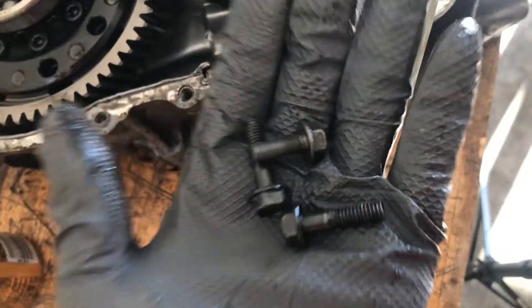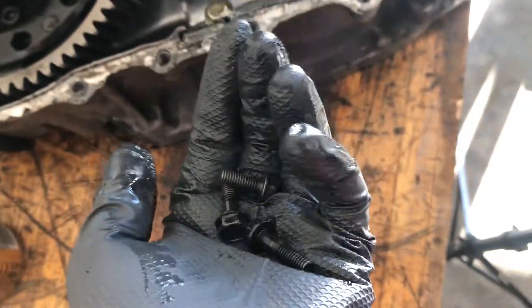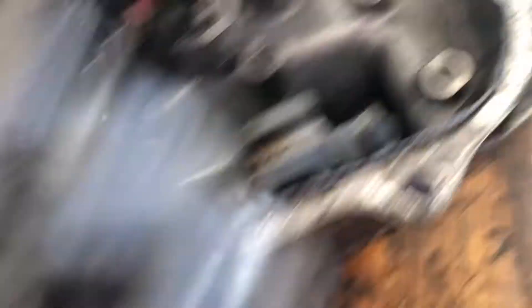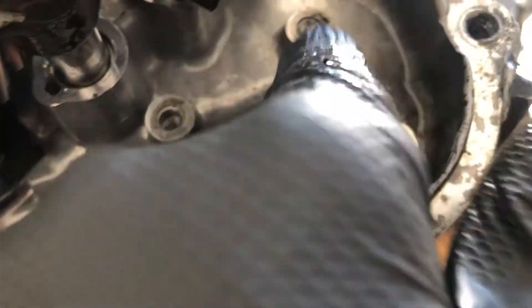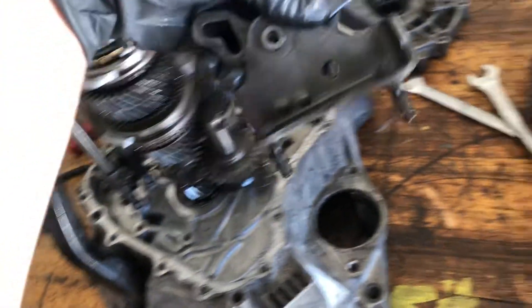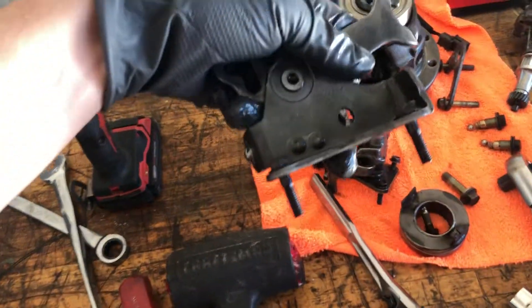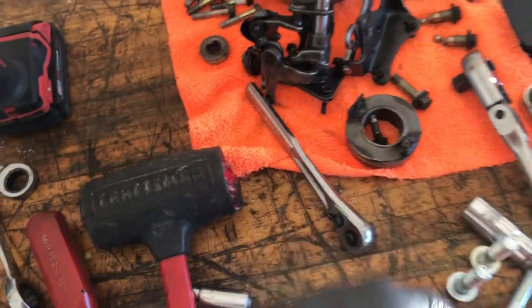That's the shift selector. As you can tell, these bolts are different — one is different from the others. Look for the shoulders on the bolts; those have been countersunk, and this one has threads going all the way down. That'll be where the shortest bolt goes, and the two longer bolts go right there if you ever get confused. This is a reverse idler gear so it has something to do with selecting reverse. Both bolts are the same size, so just make sure you don't lose them.